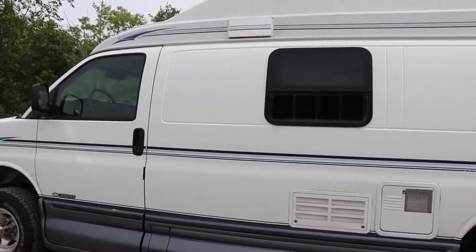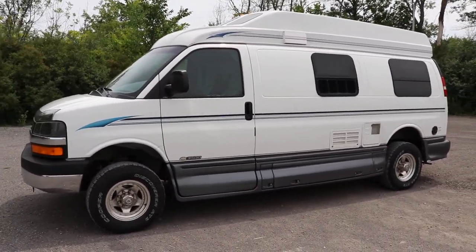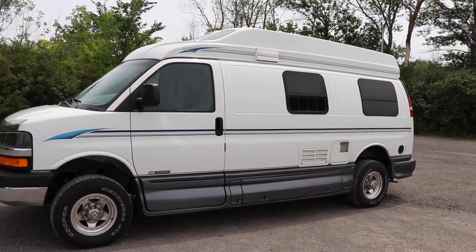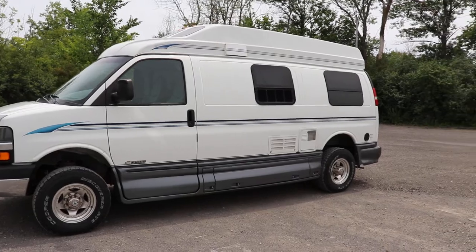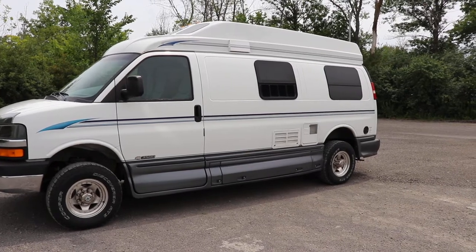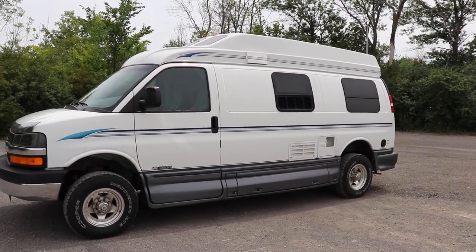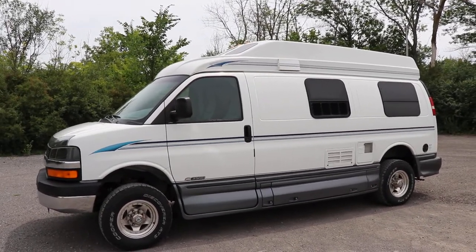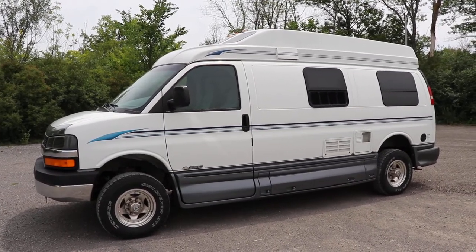I did some videos about towing a trailer. We sold our house last year and this was our main tow vehicle — we've had this over the scale at 16,000 pounds with a 7x16 wedge nose trailer behind it. It did well, but I would say it was getting to the limits. This has a 3.73 rear end — you can get a 4.10 in them. The problem was the handling was getting a bit mushy, and you have to be a little more careful. If you're driving 12 hours a day you might get yourself in trouble, but for short trips it's not a big deal.